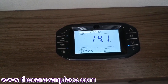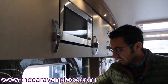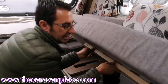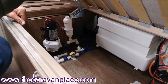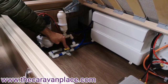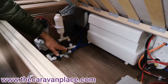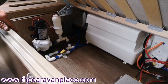Before we put the water pump on there are a couple of things to do — basically making sure all taps are in the closed position. The taps are over the sink, and just underneath the seat here is our drain-off valve. During winter or if we're not going to use the van for a while, we open all the taps and then lift this yellow bung into the upright position and that will drain the system down. When we come back, we put this back down, turn all taps to off, then go ahead and put the water pump on.